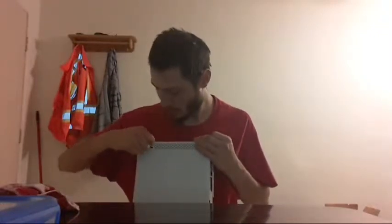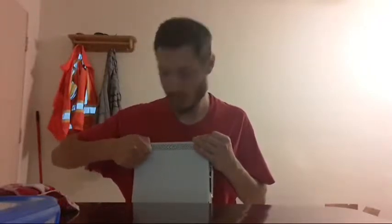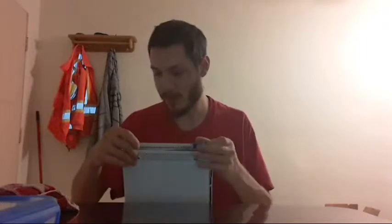I've done the penny trick on other Xboxes and it's worked, but for some reason this one didn't want to start up. What I'm thinking is I put the pennies in, but as I was putting it together, I have a feeling that the pennies moved off of the chips. So they were pressing on the board in certain spots, causing damage.